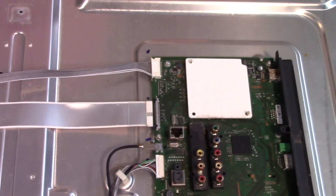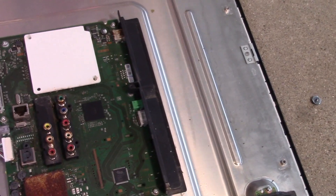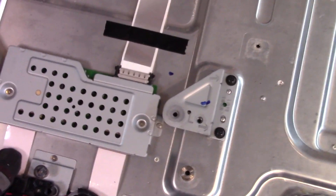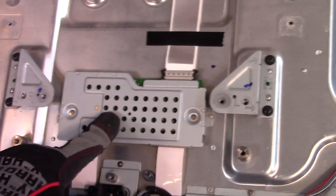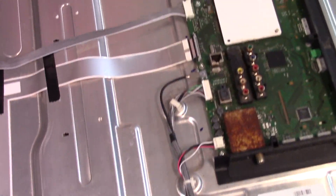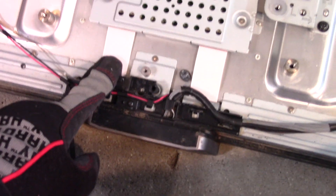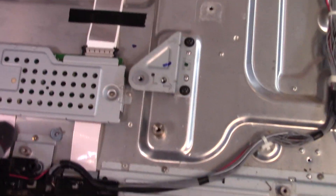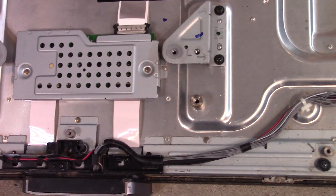Here's your input from the power supply — you have all your different supply voltages. Here you have your decoded video output. This goes down here to this LCD vertical and horizontal control board. This would take the decoded signal from the image processor somewhere on this board and it would continue to decode the data and route it through these two cables to the display. These are the only two little cables that go to the display, and an HDTV would have a whole lot more connectors going to the display.